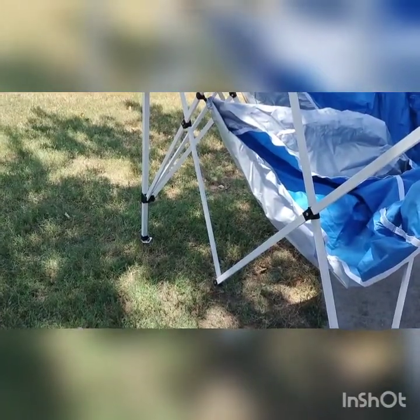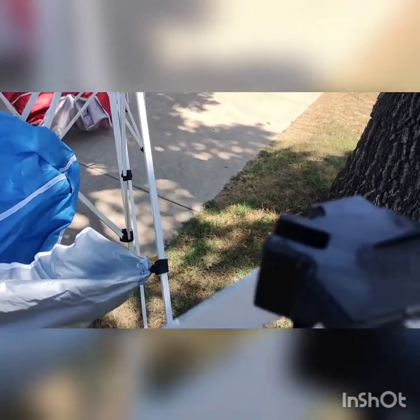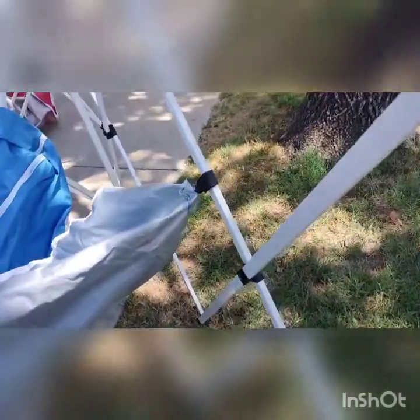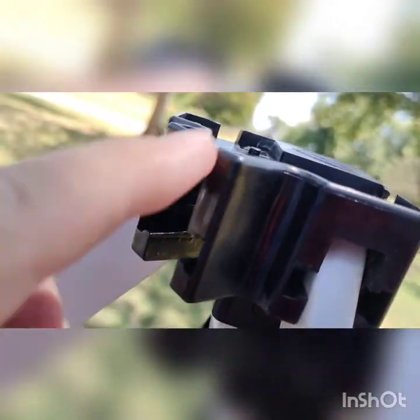I think I can just cut the top or the bottom off. For disassembly — if you ever have to fix one of these and you find some parts, or find one on the side of the road — you can get a screwdriver and pop this cap off. There's a little tab right there, just be gentle. That's how these arms come out; they're just a little plastic deal. You could even swap that out if the clip or pole broke — get a piece of metal or just another unit like this.